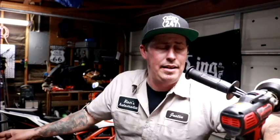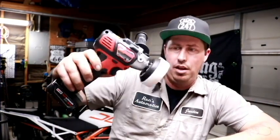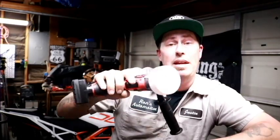You know, number one thing that I was thinking of when I was using this on my bike was that when I was detailing, when I worked at Kiefer Mazda, and all I had was the DeWalt, this would have been phenomenal to get around moonroofs, maybe even around door trim and stuff like that, and around headlights like Jeff had explained. But I remember this one moonroof had a rubber seal, and I was going a little too fast, got a little too close, and I accidentally left a little tiny burn mark. Lucky for us, it was a used car, so I got a little slap on the hand, but you know, that was when I very first started. So either way, lesson learned, right? You learn to mask things off, everything else.